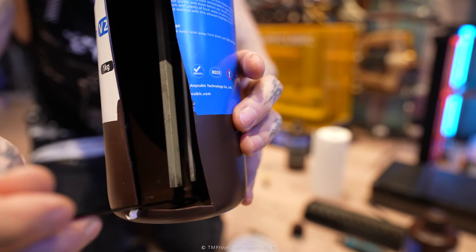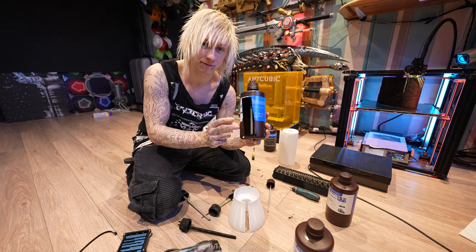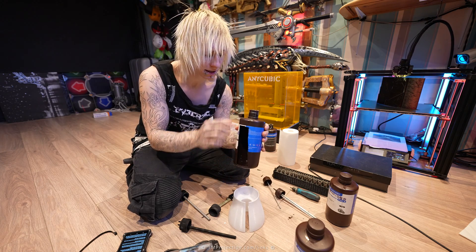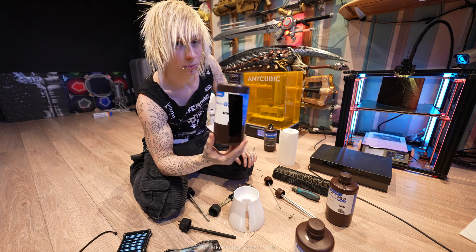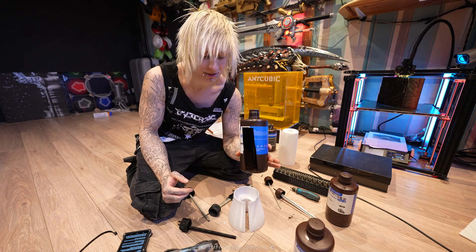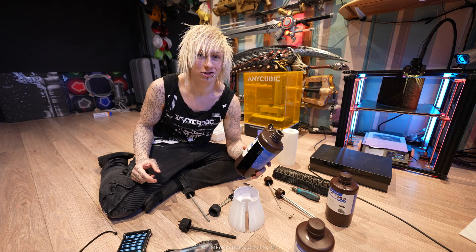I have been using my new system for over a few months now. Comparing to the original auto feeding system, there is a lot of leftover resin when you use the original system when it does work. This is because the rods cannot reach the very bottom of the bottles. After doing multiple tests, without any cardboard washers, just the resin inside and the bottle, it would weigh around 206 grams. A completely empty bottle is 80 grams. So 206 minus 80 grams equals 126 grams of resin that has not been pumped into the vat, which wastes resin and wastes your time.